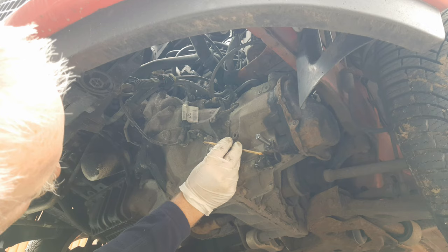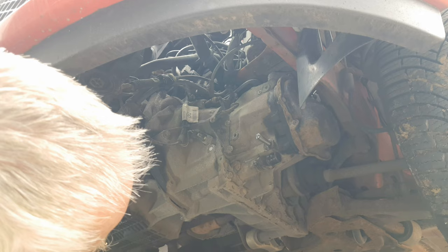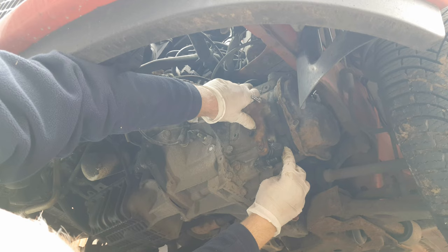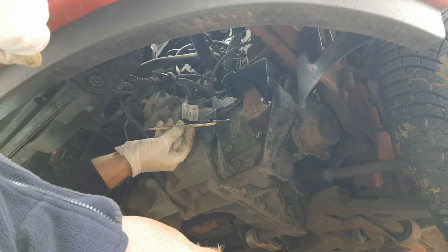Back under the car, put a little bit of moly grease inside the ball joint receiver. Take the actual ball joint part itself, orient it so that the splits in the sides are vertically above one another, and fit it into the aperture — easier done from the front. Also now put a little lube on this ball joint and on this pivot shaft. Bring the gear change lever up and offer it into position on the pivot shaft. Slide the lever onto its pivot shaft and at the same time pull the gator over the gearbox change shaft. Put your finger at the back to hold the ball joint cup in place. Use a pair of pipe grips to snap the ball into its cup, make sure the gator is properly in place, and return your circlip to the pivot shaft.